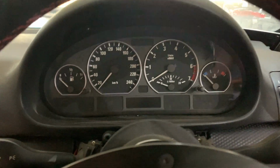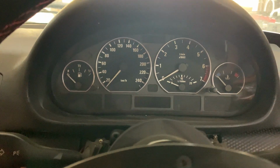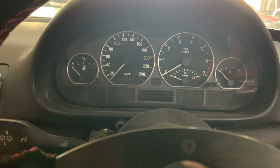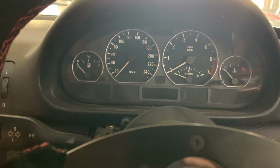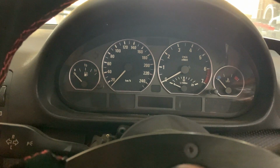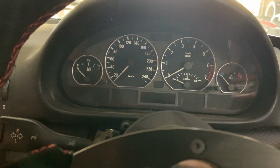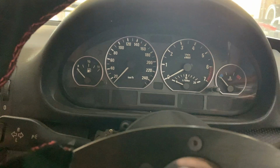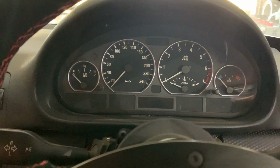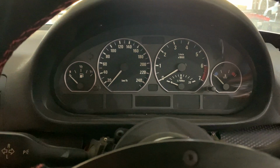Last time we spoke to you, we were trying to troubleshoot an overheating problem we were experiencing on our BMW E46 race car. Through the recent videos, you would have seen that we think we have found the problem, which was a horribly deteriorated front timing case cover, which had seen a lot of cavitation damage from the water pump. We have since replaced that with a much better unit and have reassembled the car, and we hope that is going to be the resolution to our overheating problems.